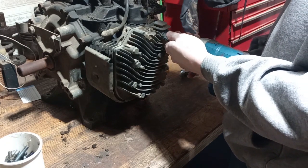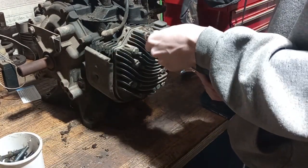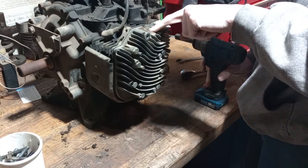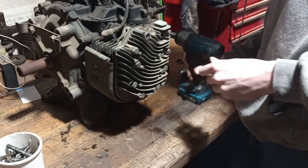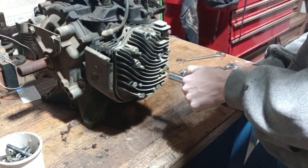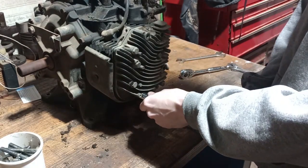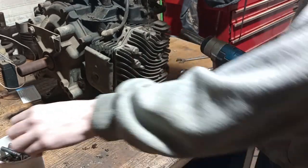This is the head here that I've had off before. I stuck a borescope in - first I pulled the spark plug on the other side and it looked like a new spark plug and was okay. But when I pulled this one it looked brand new except it was soaking wet with water. I stuck a borescope down in here and looked at that piston, and that piston wasn't moving when you turned the motor over. So I knew what was wrong - this thing had thrown a rod. I pulled the front cover, fished all the big chunks of aluminum out, and put a used piston and rod in it out of another motor.